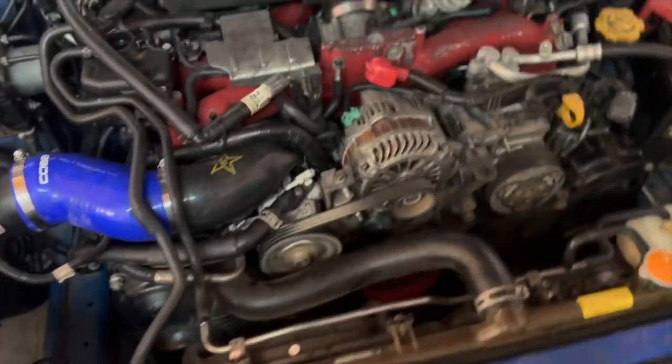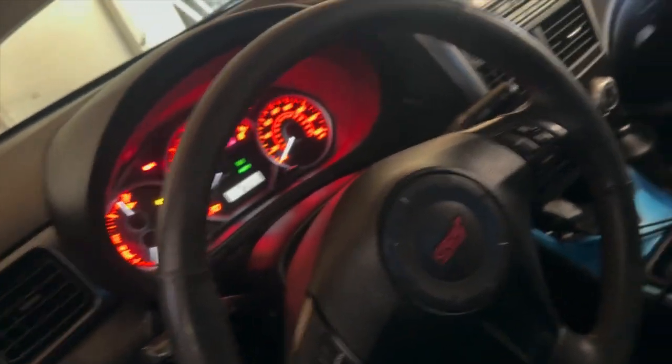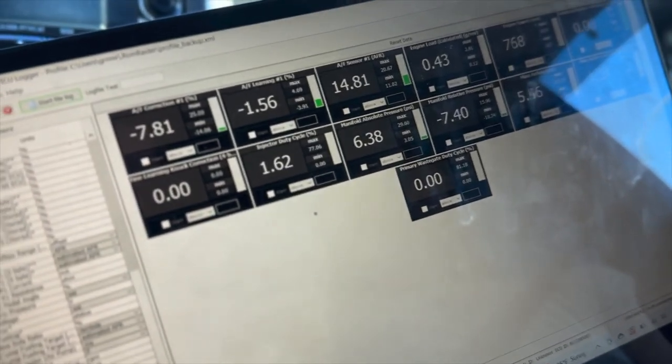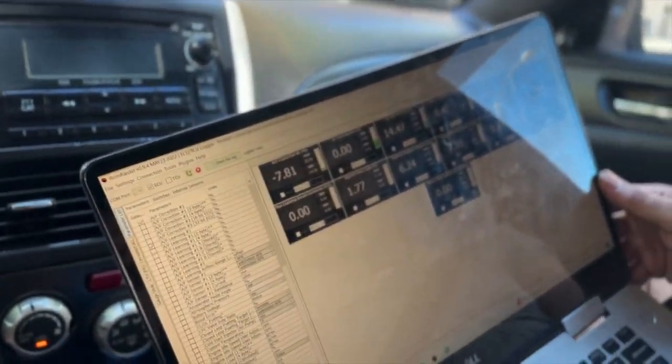Going to put coolant in, make sure we don't have any leaks, put the intercooler on, make sure the fuel lines are routed correctly, and then about ready to start it and do some tuning. First start sounds good, topped up the coolant. Cleared the codes and no check engine light — running nice and smooth. Took it for a test drive, no check engine lights, no cylinder knock, feedback hit negative four on a shift. Hitting about 15-16 pounds of boost, everything looks clean, using about 70% of the injectors. Thanks for watching — if you want another video like this let me know.